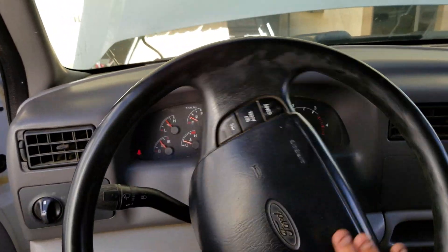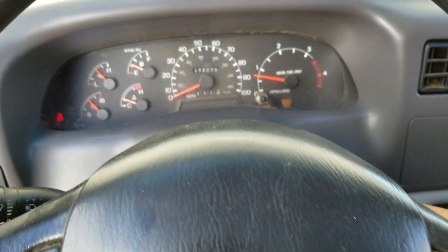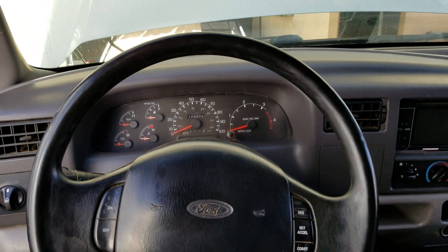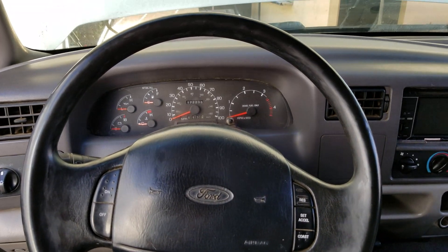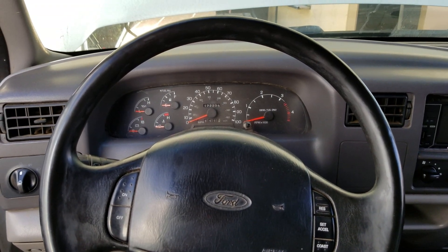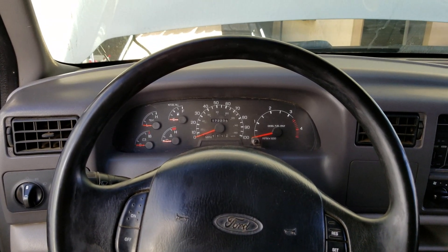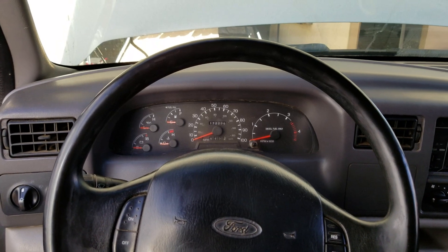There we go — we can do it! That feels good, that makes me happy. I'll turn this off now. I'm probably going to drive it around the block a few times, maybe put 10-20 miles on it, then come back and check the fluid to make sure it doesn't go low. There's probably still some air bubbles — I heard a little bit of a whine when turning — but at least I can turn when I'm stopped. Hope that video helped you guys out. If you have any questions about the project or what I did, let me know. Good luck!